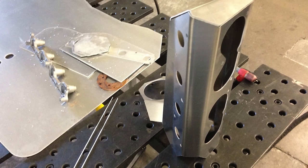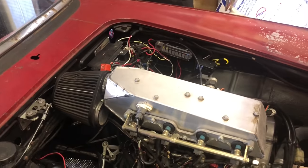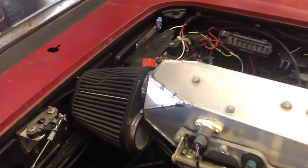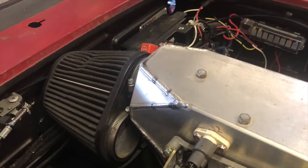I made the intake by designing it in CAD, flattening it, having it water-jet cut, bending it up, and welding all the seams. If you're good with CAD and have access to that equipment, I recommend it. If not, you can use the other CAD — cardboard aided design — piece it together with cardboard until it looks good, flatten it, trace it onto aluminum, cut it, fold it, and weld it. The air filter is a dual-inlet pod filter, which gives a larger area, with one inlet blocked off.